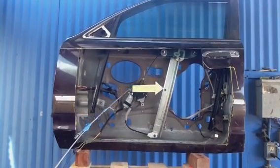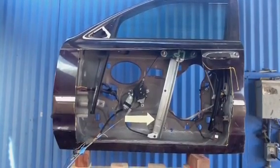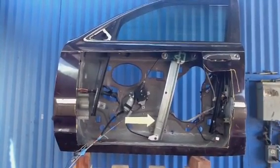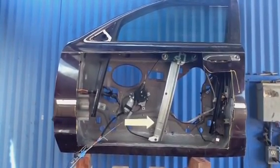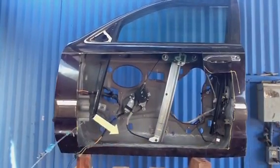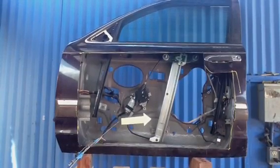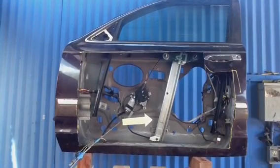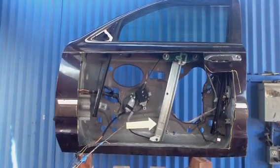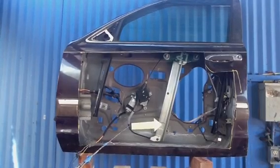When we start to do this repair, we work on the inside of the car and have to take the door panel off. That requires a special tool called a door panel tool — a simple tool that releases clips on the bottom or inside to allow the door panel to come loose. Every door panel comes off differently depending on the car, and you have to carefully search for how the particular manufacturer fastened everything and remove small plastic panels.